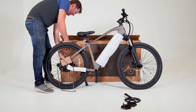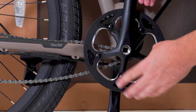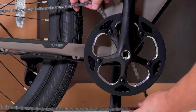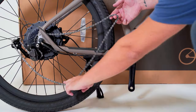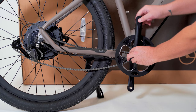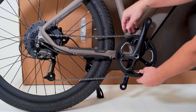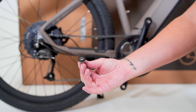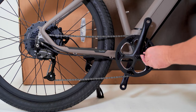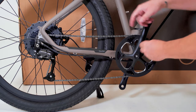With the front wheel installed and the kickstand down, you can now remove the rest of the packing materials. If you're assembling the Limited with a torque sensor, it requires an extra step when installing the chainring — please see the link in the description below. When installing the chainring, make sure the left and right crank are pointed in opposite directions, 180 degrees apart. Slide the chainring on and carefully place the chain onto the chainring. Install the right crank arm and chainring with your 8mm hex wrench. Tighten bolts on both sides as tight as possible by hand, or if using a torque wrench, to 40 newton meters.